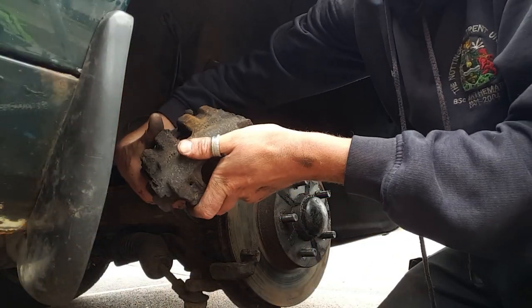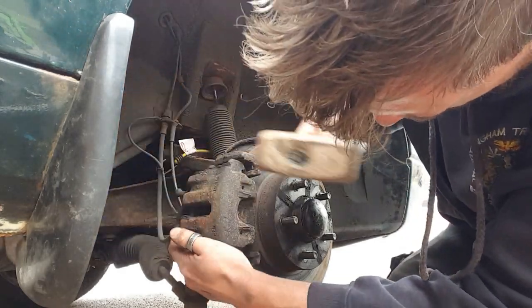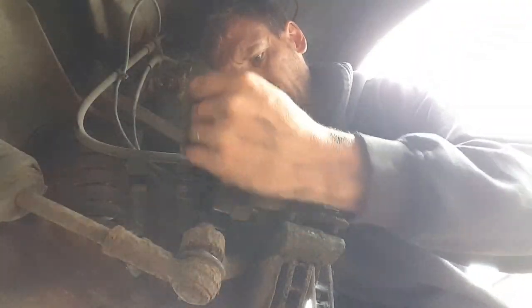Although I did get the caliper back onto the disc, I was having to use a hammer to get it on, and I was thinking at the time that I really shouldn't be having to do this. When I got everything back together and went out for a drive, I was noticing that even at very slow speeds when braking the ABS was kicking in because I could feel it on the pedal. I suspect that what the car is thinking is that I'm braking harder than I actually am, because the pads are making too much contact with the disc, and I think the reason is that the piston is too far out and isn't depressing enough.